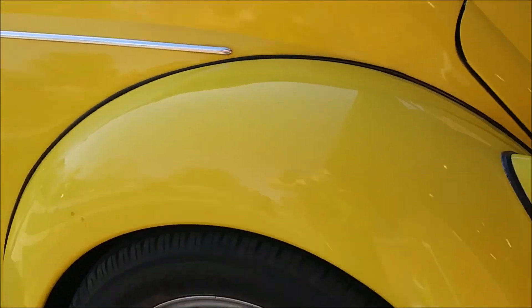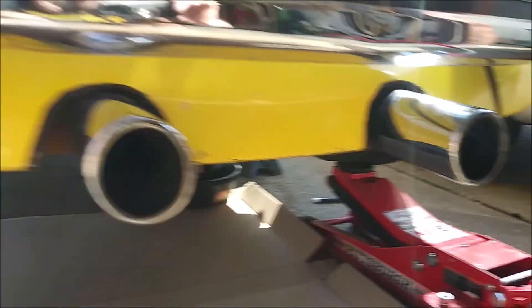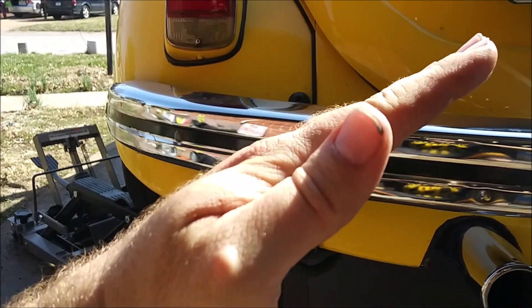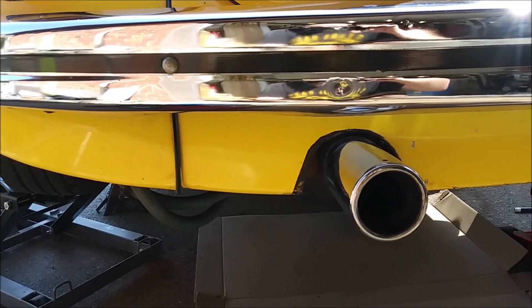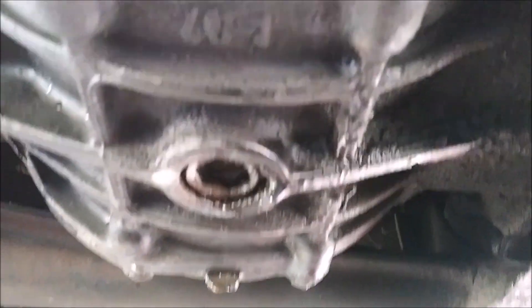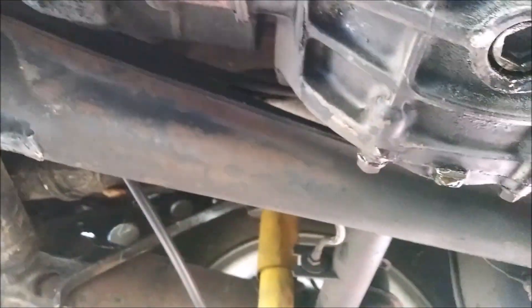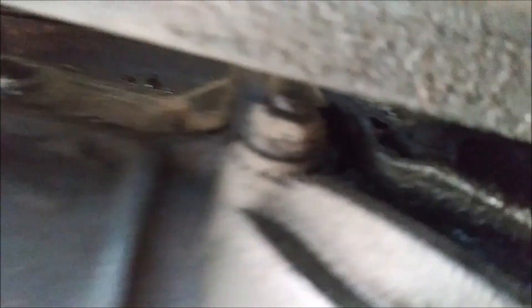The car is kind of sort of level, but the rear has lifted up slightly because I lifted up on the rear wheels so that the swing axles are more level. Swing axles are full of gear oil, unlike my '74 Super. Sliding underneath here, we have a drain plug here, a drain plug towards the front — in case you have this thing tilted slightly more to the front you can get everything out. And here is our fill plug.